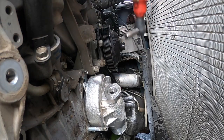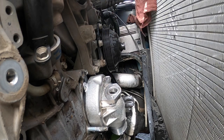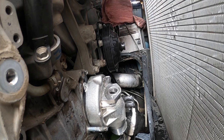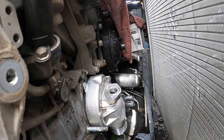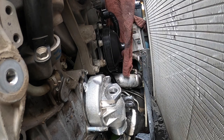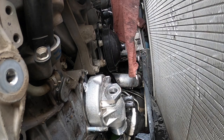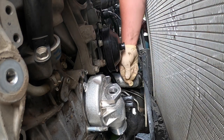And then we are changing the lower hose, so I'm not going to reconnect it right now. I just want to get everything else hooked back up. Here we can put the... We'll get the pipe in. I got to connect the two nuts on the back pipe right now. Just cleaning it off. It's got a lot of stuff on it. Remember the two 12mm nuts, you gotta put them on the back. Can't forget about that.